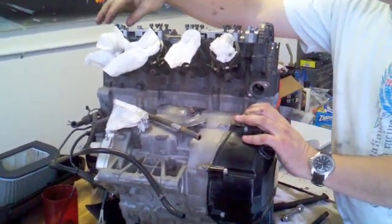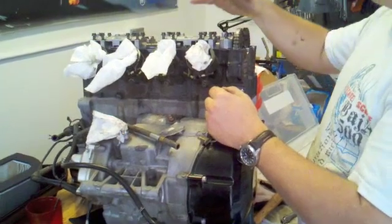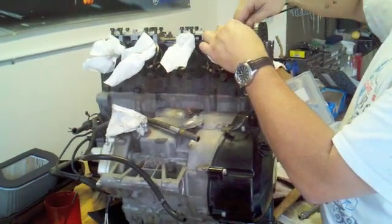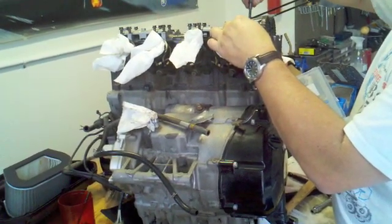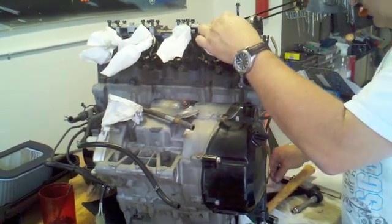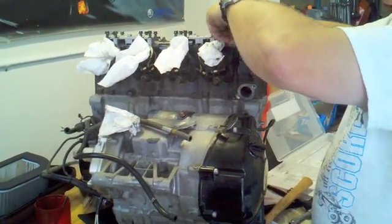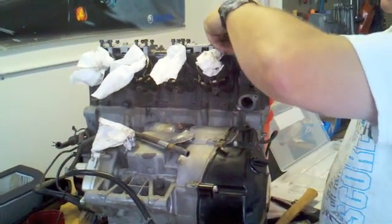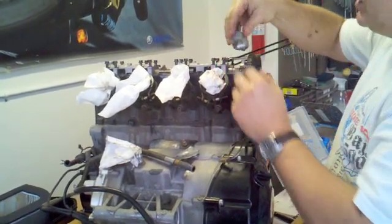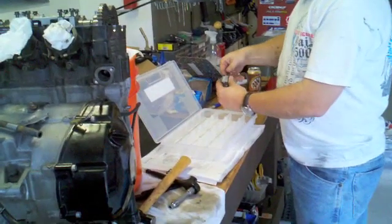After that you can do the removal of the cap that goes on the intake cam. Next, remove the caps from the camshafts — this is the intake side, we'll do that first. I've gone through and loosened all the bolts. Once the bolts are loose, notice they have a female fitting you can feed in here in order to jostle it and pull it loose from the dowel pins that are underneath. These won't just pop right off — you've got to pull these a little bit. I'm going to be putting all these caps and associated bolts in a little tool organizer here.